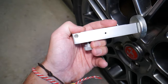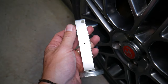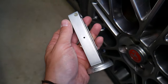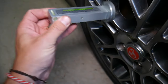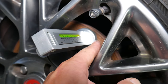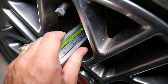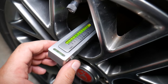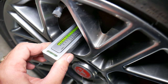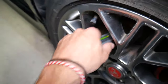You need to make sure your camber tool is actually leveled — if I adjust this screw, check out how the tool will tilt. So I need to make sure it's completely level, then place it on the rotor. Make sure you don't catch the lip of the rotor. Ours is reading past six — all the way to about six and a quarter — so it's currently about 6.25° negative.